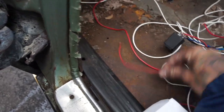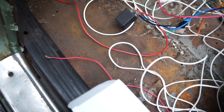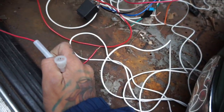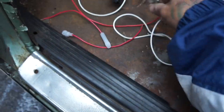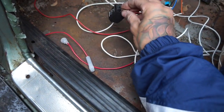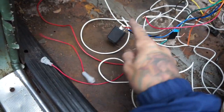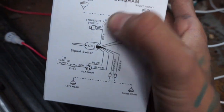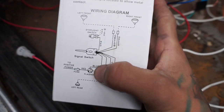The fuse blew yesterday while I was experimenting trying to get this working. I messed it up somehow, so I took out the fuse and connected the red wire directly to a fuse up here — the same place my radio connects — which is positive power. So the red goes to positive power, blue to B, black to L.